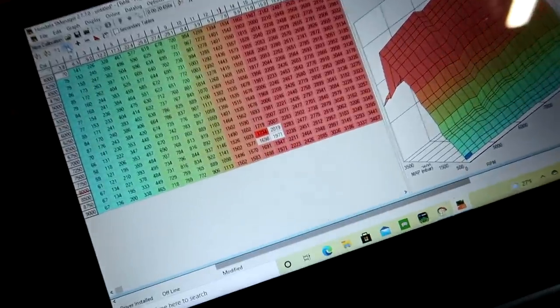She definitely got a little angry up top. I spun it to 8500 instead of about 7850–7900 on the last pull. You can see the lower blue line is the one we just did — it made more power because I revved it a little higher, but it didn't really want to keep going. I gotta air out the shop a little bit. I did feel this on the street — up top it just gets super anemic and doesn't want to keep revving or making power.